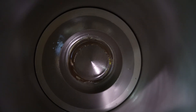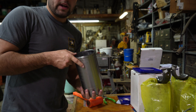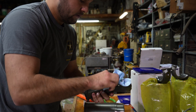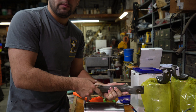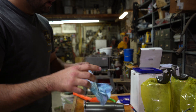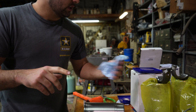On the top of that cylinder there you can probably see a little arrow — that's the front, orientating that piston to the front of the engine. And then you've got your rod here, and it's also got a front marking right here that says 'front.' That front marking will orientate with how I've got the piston laid out. You've got to make sure that happens because that bowl on your piston is not centered — it's offset a little bit for the injector, for how it sprays.